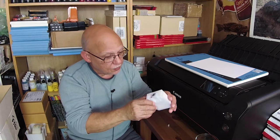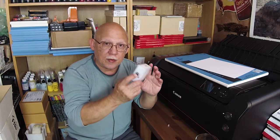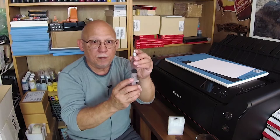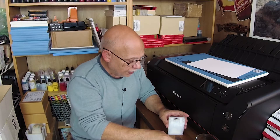These cartridges are only used one time and then you toss them or recycle them — you're not supposed to refill them. But by doing this process very carefully, you will not damage that very critical part: the o-ring. Make believe this is the stem that enters from the printer when you insert the cartridge. That o-ring has to seal against that stem. If it's not sealing, as pressure is applied to the bag, it leaks around it and all over the place.